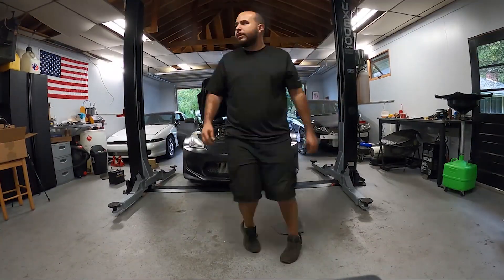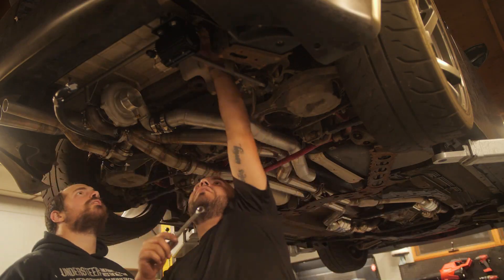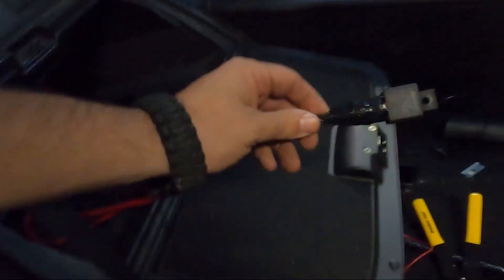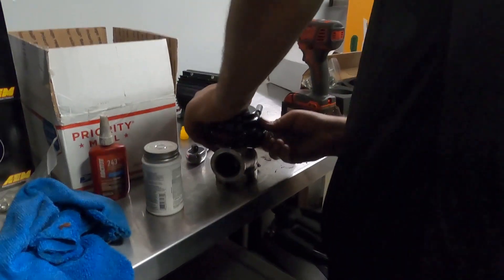We had just three days to put the rest together before we got the trailer and headed to Limp Mode Tuning up in Maine. It was a mad dash and I tried to help as much as I could. I have a lot of respect for Denny as he is a master at his craft and was willing to teach me along the way. We hooked up the turbo, mounted the scavenge pump, and wired it to its own power source, routing the oil feeds and return lines, hooked up the gauges, and mounted the wastegate with an 8-pound spring.